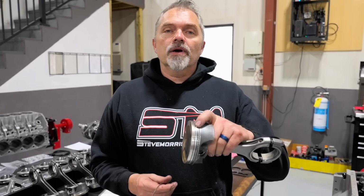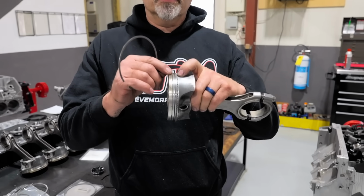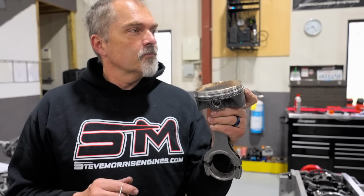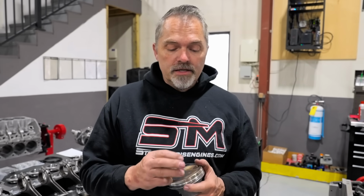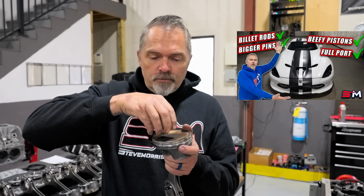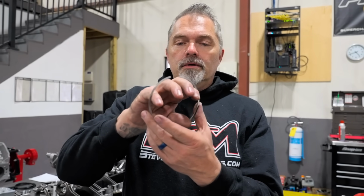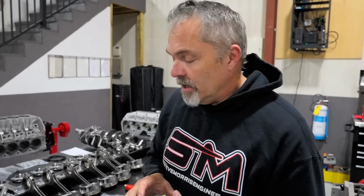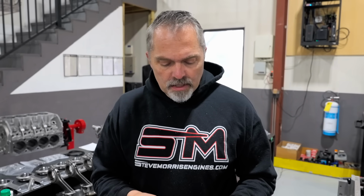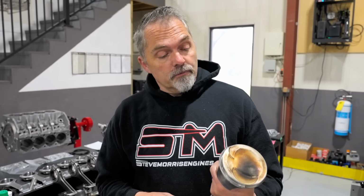And if you recall from our conversations about gas porting, this has a lateral gas port. Fancy. And so that is helping to expand out. If you want to go back and look at that video, it puts pressure behind the ring, forcing the ring out to seal like that. So that helps that radial tension. If you didn't have a gas port in here, it'd probably still be okay. I don't think it would have any kind of problem, but it does aid in it and helps keep it sealed better. So I thought I'd just tell you a little bit about the ring stuff.